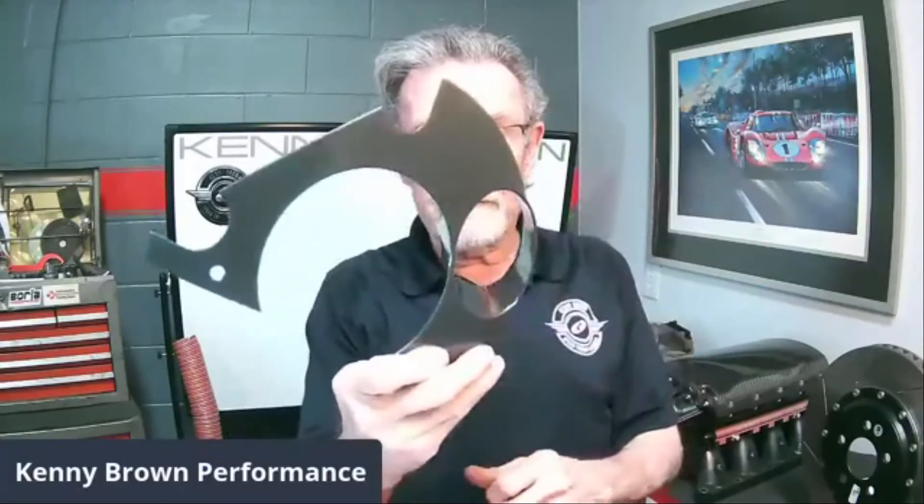This second design is for the SN95 — it's a two-piece design and it's also oval. Someone asked about a Fox body: if you're upgrading brakes and brake ducts and converting a Fox body, use a 1996 or newer SN95 spindle. The steering geometry is better and brake ducts fit better. So for a Fox body conversion, 96 and newer SN95 spindle is the way to go.